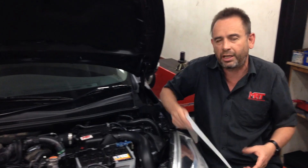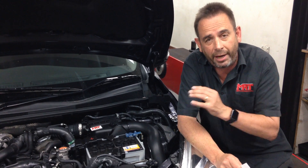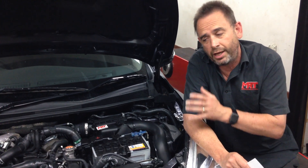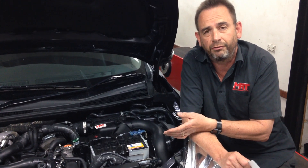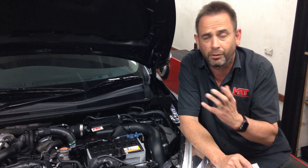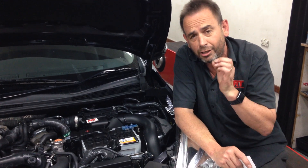I'll take a still photo of the dyno graph so you can have a closer look. What we've done on this particular car is deleted one of the catalytic converters, which has had a huge increase in flow by reducing the back pressure associated with factory catalytic converters. The car still has an original cat, but one has been deleted, and then we've done a back-to-back custom tune — that dyno graph is the result. Even if you completely replace the whole exhaust system, the result is exactly the same. There have been people on the internet who think putting three-inch exhaust systems or modified air intakes will give some miraculous increase in performance, but the facts are you still don't get any huge increase in power.